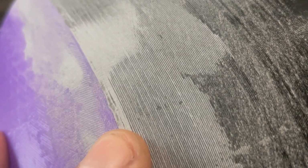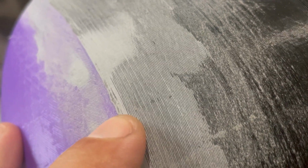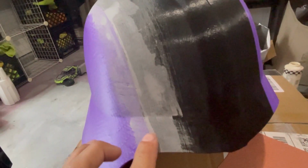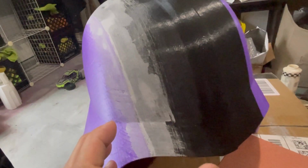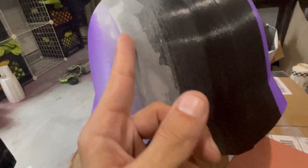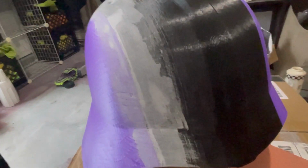As I mentioned before, the reason why you want to be careful with body filler is because it is, in theory, a polyester resin with a cream hardener. And anytime you're adding a hardener to it, it shrinks to a certain degree. What's nice about plastic metal is it doesn't shrink. There's always that chance that if you fill this larger gap in with body filler and it shrinks, and I'm sure it's happened to you, you get a whole line, it looks like a crack. But what it is, is it shrunk and separated from where it was applied.